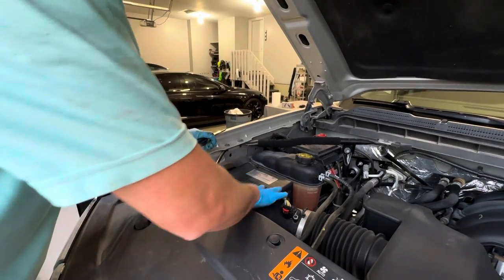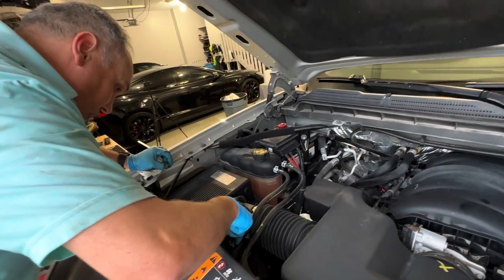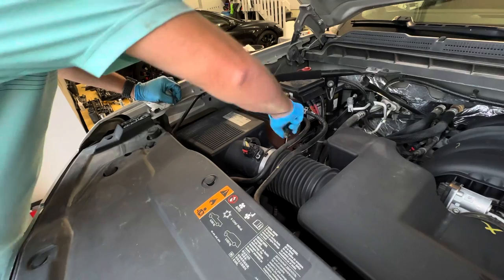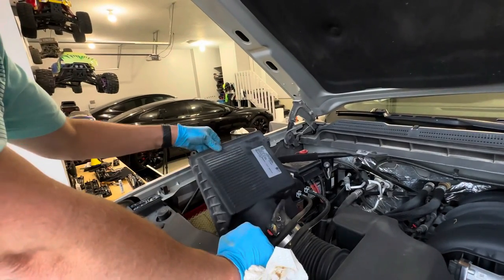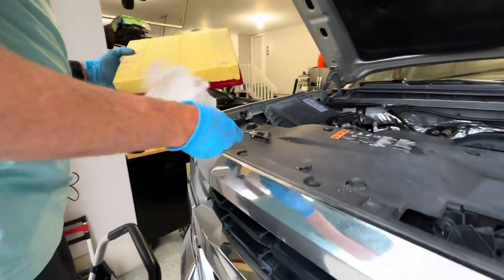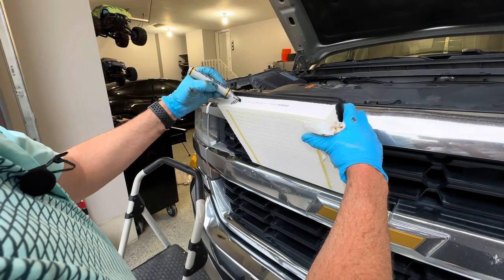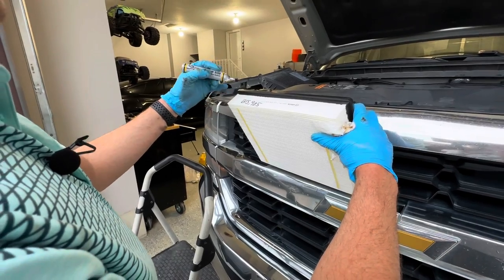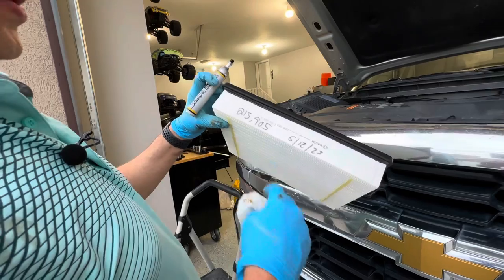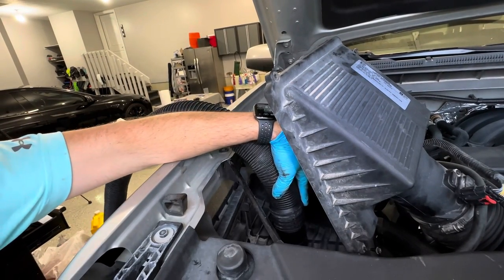Before we close the hood, I'm just going to change the air filter. GM's still doing these Phillips head screws on here, which is kind of strange — just four screws. I've never even looked at this. I just got this truck so I don't know what condition the air filter's in, but I'm assuming it needs to be changed. You have to maneuver the lid around the little support brace on the corner. It actually looks pretty good, but I'm going to replace it anyway just to start off with a new one. I like to write on the filter: 215,905 — that's the current miles — and 6/12/23. That way we know the mileage we changed it at, and if you take it to a shop and they bring out a dirty filter without your writing on it, you know it's not yours. I'm going to get my shop vac and vacuum the air box — there's some dirt and debris in the bottom and I don't want it going into the new filter.